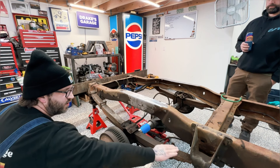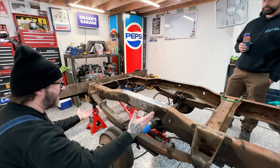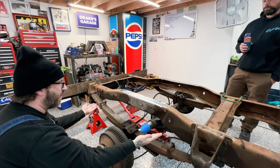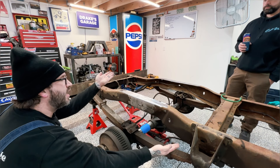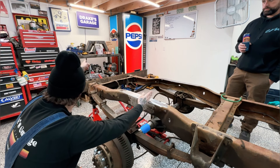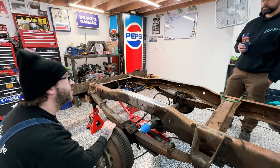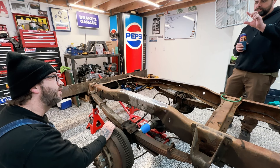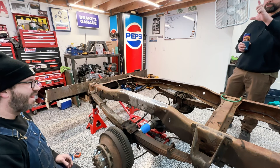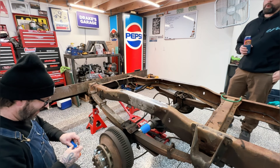Since those lower arms bolt onto your leaf perch, going underneath the axle — and then obviously as it goes up, it rotates forward, back, and then forward again. I need to figure out when it goes all the way up and it's maxed out at full dump, how much more that axle moves forward. I'm going to offset my notch to that. My guess, it'll probably be like three quarters of an inch, so when this thing is at full dump, it's center of that notch. It's a math equation — we're saying it makes sense, but the formula to figure out the math before we just put things in place, that's not for us.